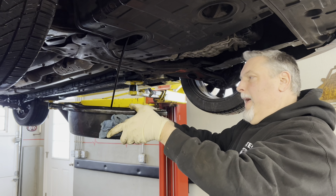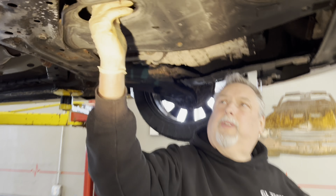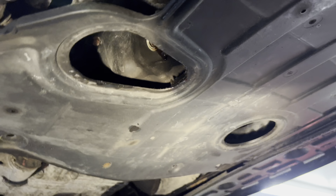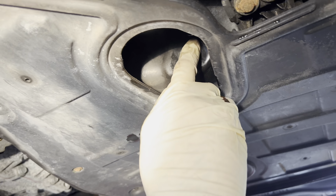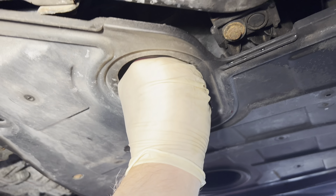I'm trying to not make a mess. We've got our drain plug — make sure it's clean. The gasket stayed stuck to the pan up in here. It's nice and clean. So we're going to put our plug back in and snug it up. It's a metal seal gasket that's on there. We've got our 17 millimeter. We're going to snug it up, then get that oil filter off. Tight with that. I'm going to wipe everything down nice and dry.